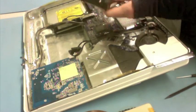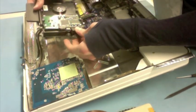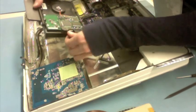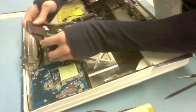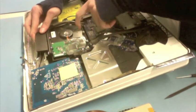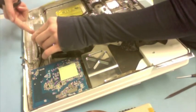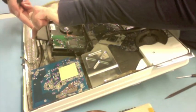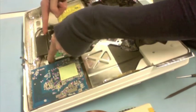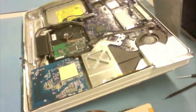I'm going to pretend that it's all ready to go. I'm going to plug it in to SATA and power, and make sure that those T8s are firmly in the brackets at the bottom. Make sure that there are no cables underneath where I'm going to be laying this drive, and I'm going to lay it down. I want to make sure that I hear that nice click and that the drive clicked firmly into place on the rear bracket. The drive's in place.